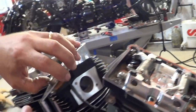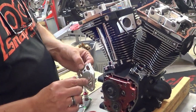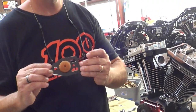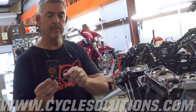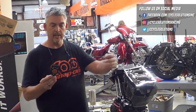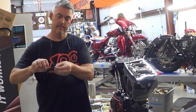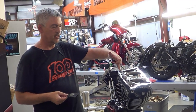I want to explain how these breathers work and why it's so important to have proper stuff. This is a factory part for the 06 and up style head breathers. They have a rubber flapper in it, and there's a pair of gaskets — a round one goes on the top, this one holds the actual filter in and seals the bottom. It's got the inlets and the outlet. What happens inside is when the pistons go down, pressure grows. It travels up the pushrod tubes into the rocker box, the pressure vents into the breather top body, lifts the flapper, enters the top of it, goes down through a hole, travels across the galleryway and comes out.